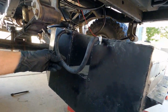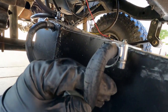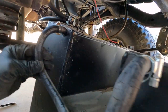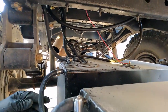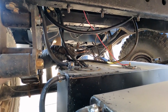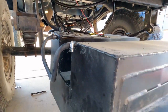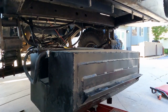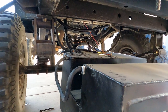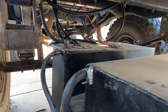All right, so this monster tank is down finally and it's almost full. See the cracks in that vent hose? I'm sure you can see it all the way around — that's nasty. That's definitely part of our problem. And then we've got some clamps that just slid down. Other than that, I'm going to go pressurize it up. I'll leave you guys right here so you can hear Kyle scream when things catch fire — no, we're good, we ain't burning the Scrambler down.